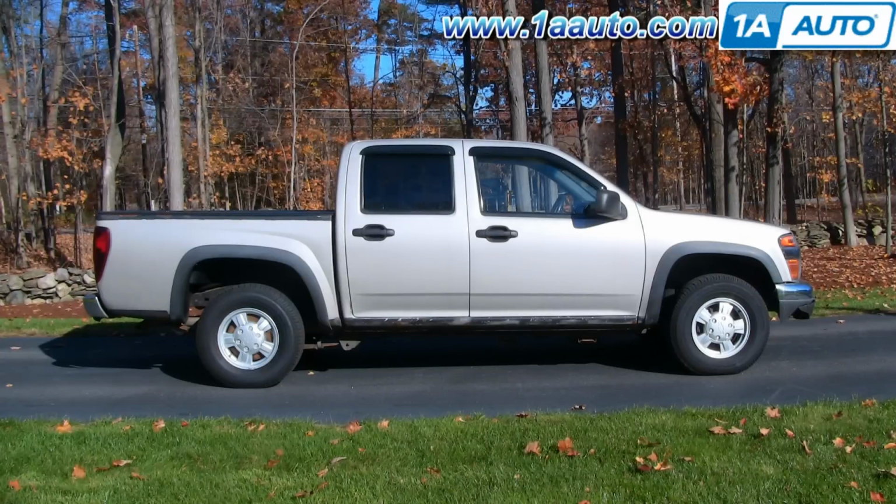Thanks. In this video, I'm going to show you how to replace a front window motor, also how to replace just a regulator on this Chevy Colorado. I'm going to show you the driver's side door. Passenger side door is basically the same. It's a fairly easy replacement. The tools you'll need are a Phillips screwdriver, a 10mm socket with a ratchet extension, a Phillips head socket driver, and a pair of pliers.